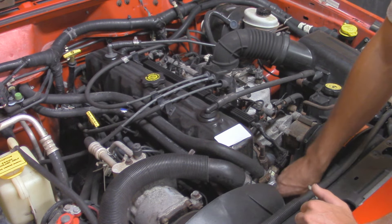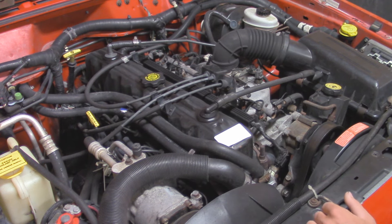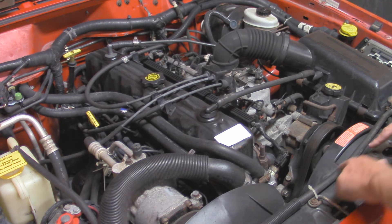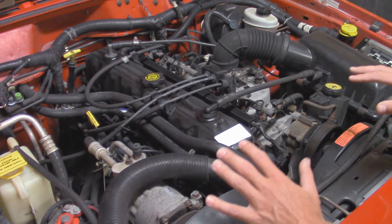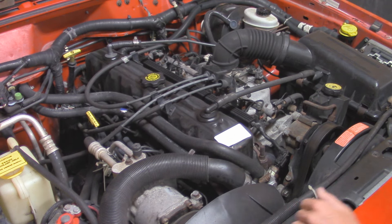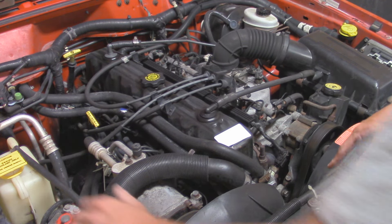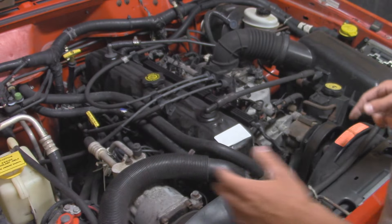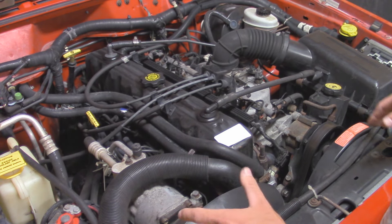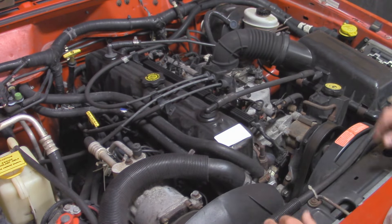Right below it on the front of the block, we have the water pump, which circulates all the coolant throughout the system. I should also mention this is an open cooling system. Over here we have a radiator cap and an overflow tube that goes to the overflow tank. When this heats up, it creates pressure inside the cooling system. This pressure cap is rated at about 16 PSI, so whenever the coolant reaches 16 PSI, it lets off a little coolant into the expansion tank so nothing bursts. When it cools down, it retracts that extra coolant back into the cooling system so it stays topped off.